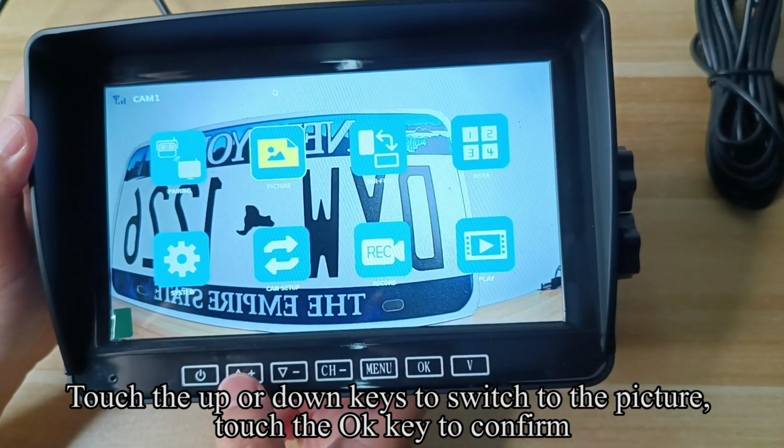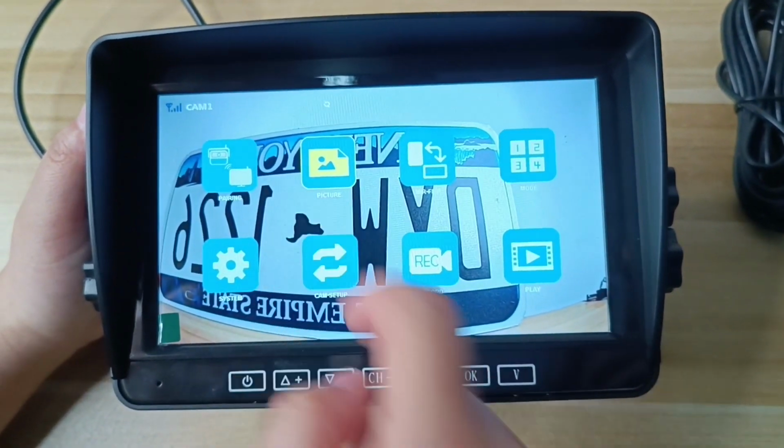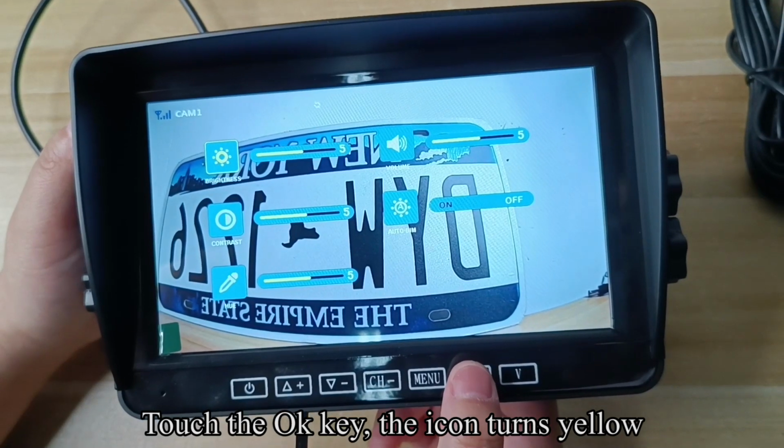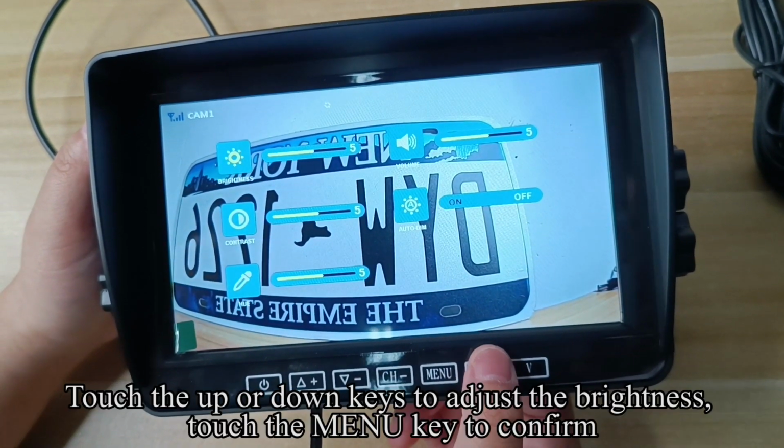The easiest way is to connect the monitor to the cigarette lighter outlet. Plug the cigarette lighter adapter to the power outlet. Press the red button. The red button lights up. The monitor lights up and shows no signal.